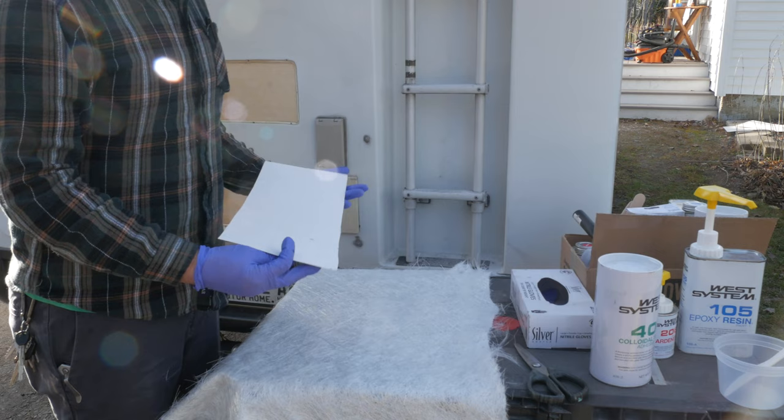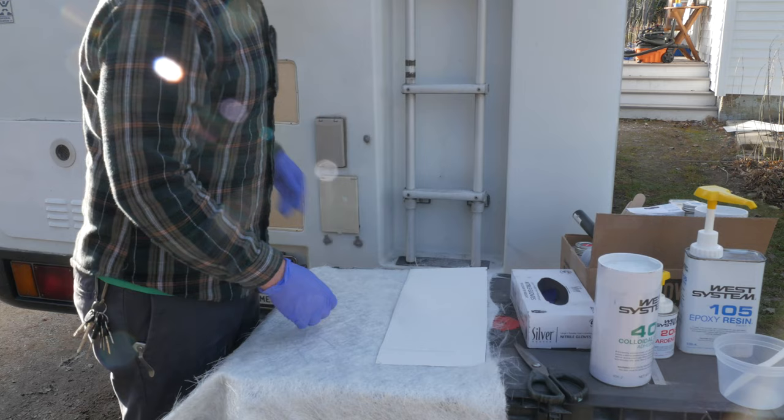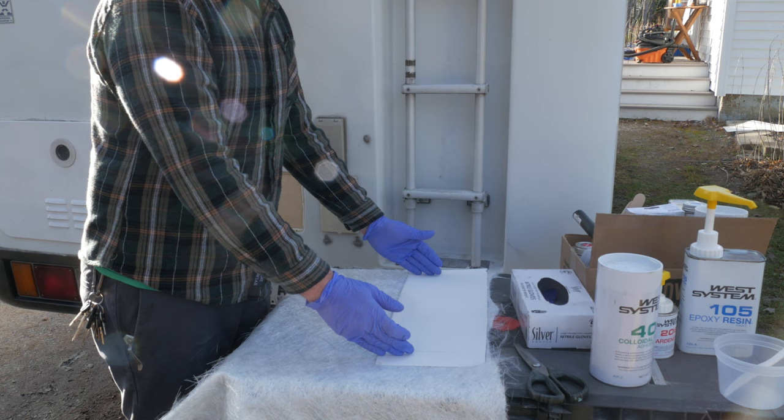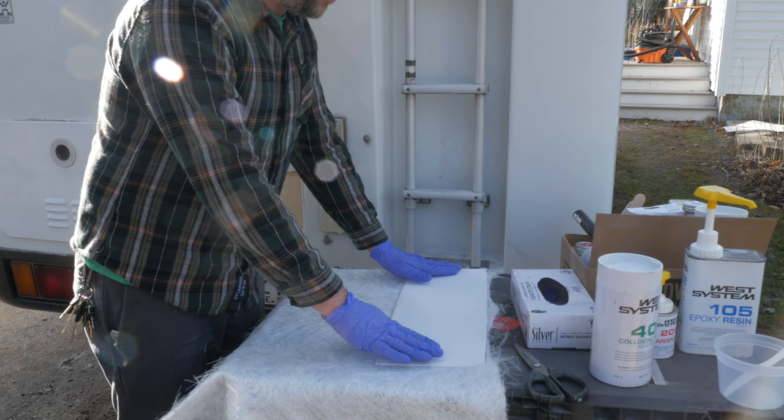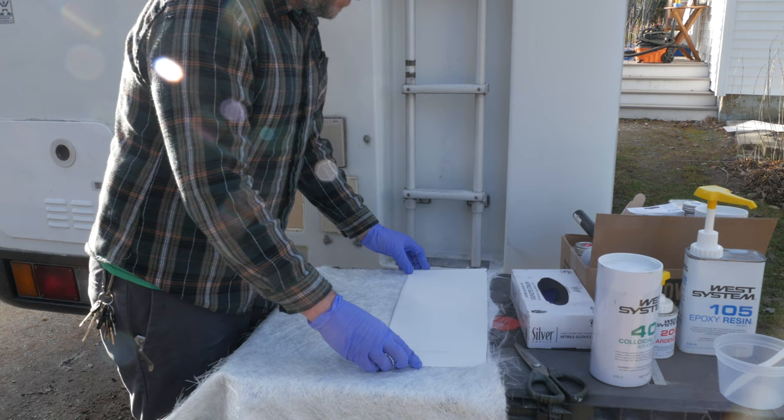Okay, so I also cut out a template to match this. So the idea is cut out multiple pieces, but have the largest one first, and then layer the smaller ones in the center, and that should level it out for the ramps. This first piece will keep it all structured within the wall, and if you layer it in with smaller pieces, it'll bring it to the same level and be structural. So we'll give our best shot. Not gonna be perfect.